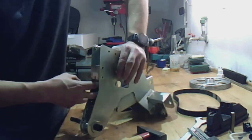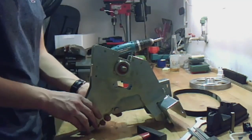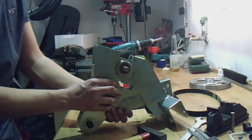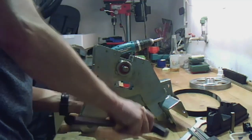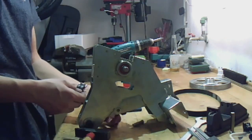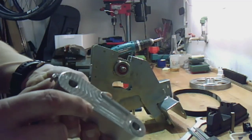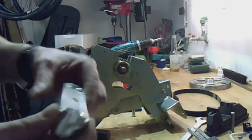Then I always have a look if it moves freely. So if it goes a little strange, I have a look inside where it's touching. And so I remove it again. So, and there, if you can see, two little wings, and I remove a little material where I can see the mark. Also, sometimes maybe on this side.